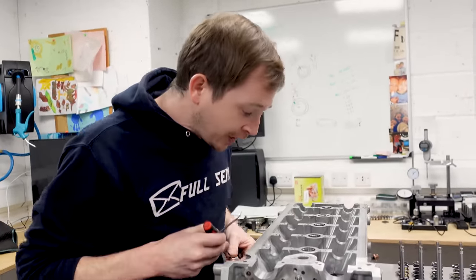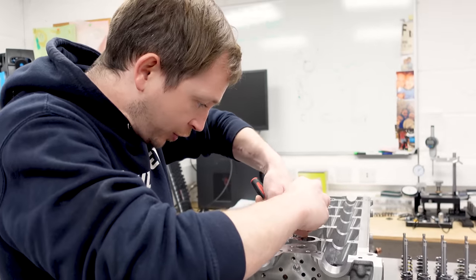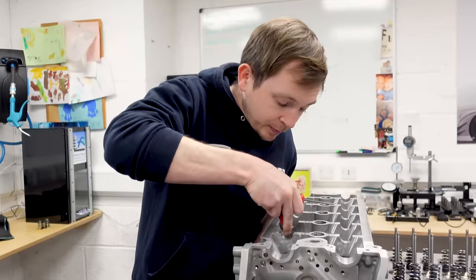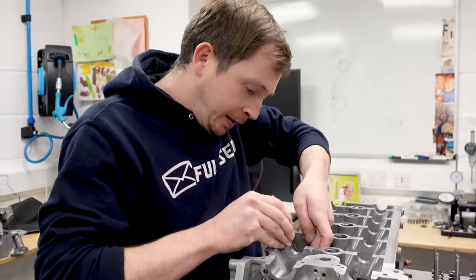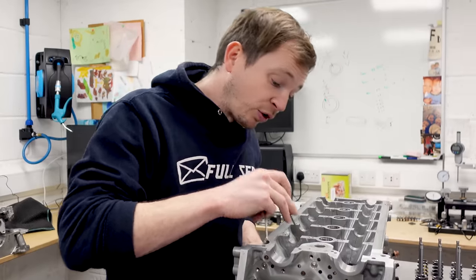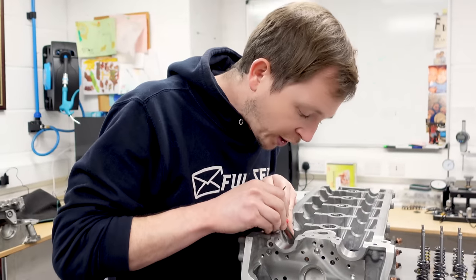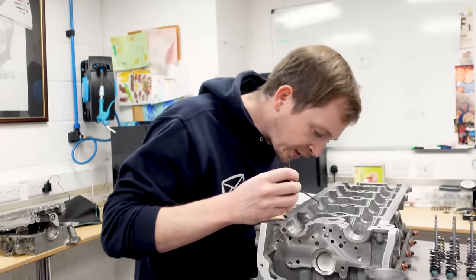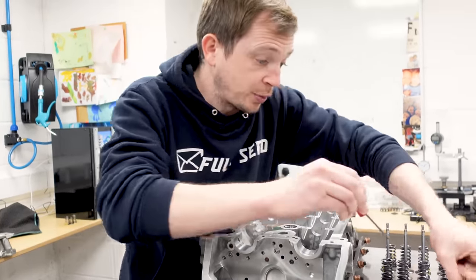So what was the deal with this engine? This is just a race engine, just a refresh. Original pistons and rods but we changed rings, rod bearings, rod bolts, main bearings, and we've put a complete valve train in it. We don't know the history of this one so I said to them, look, pistons and rods look mint, but let's put a valve train in. Brand new valves, brand new springs - even if we don't do valves we always do springs, because I've seen broken springs on stock engines.